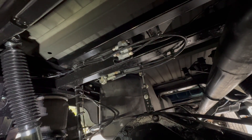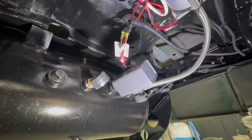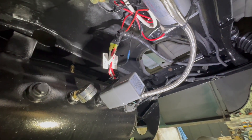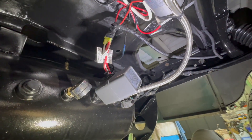What we're going to be talking about — we're going to try to keep this short and to the point — is explaining the air suspension a little bit more. This is a very simple setup, and obviously to begin with we have to have compressed air. What I'm running is just a 12-volt compressor plumbed into a tank. We've got a pressure switch here — this is a relay pressure switch all in one. You can choose however you want to do it, but basically we need compressed air.